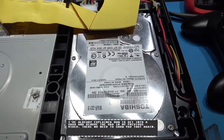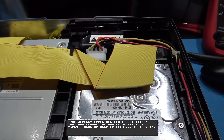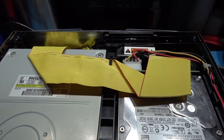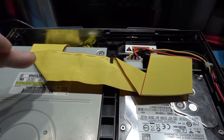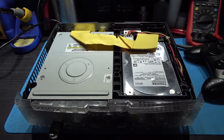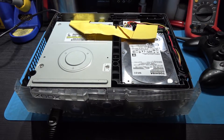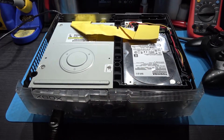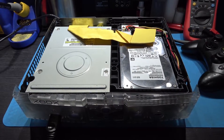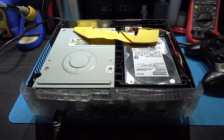As you can see, I have the two terabyte hard drive in the Xbox now. Just a word of caution: if you're going to use one of these IDE to SATA adapters, you're also going to need to update your IDE cable. The old 40-pin cable that's in the Xbox just won't cut it — you'll need to update it to an 80-pin, because if you don't, you'll get hard drive timeouts, error sevens. If I get error code 19 or 13 that's a really good sign, but if I get error seven it could mean a problem with the SATA to IDE adapter or the IDE cable.